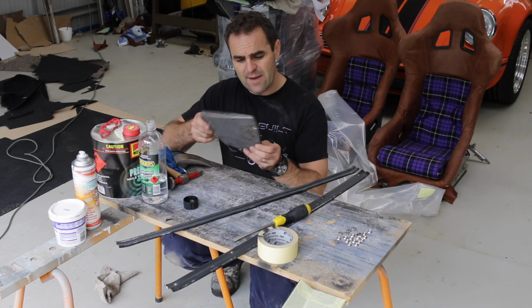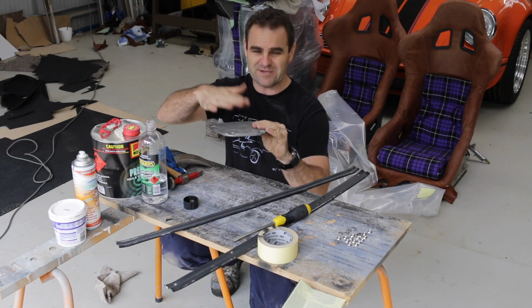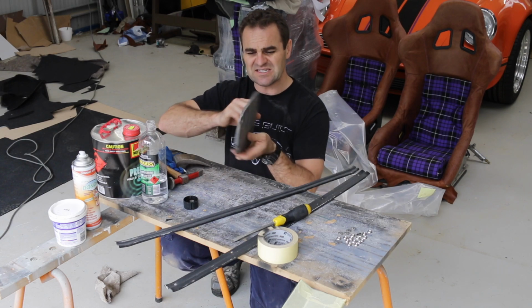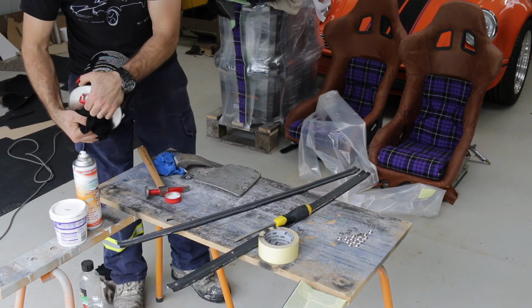All right, a little bit of work with the hammer and dolly, and this is looking pretty decent now. It's actually got the nice curve back on the top of it. Before, it was pressed in, dented. I'm sure I've rested on it in the past, and it had some kinks around the edge. Rust proofed, I've just got to clean it up and paint it.